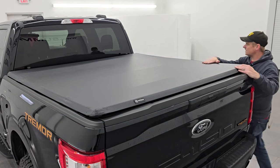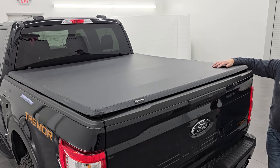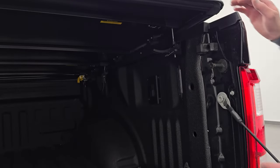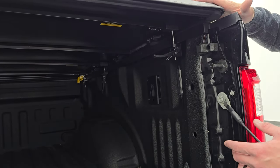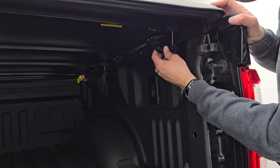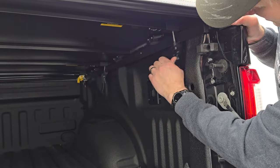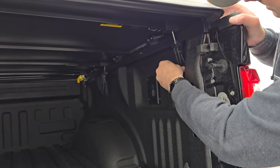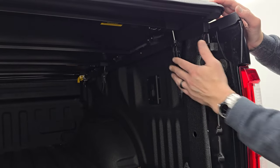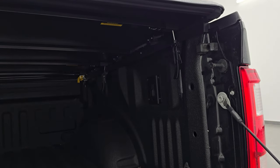As you can see, you get a nice flat surface and it's going to protect from rain, snow, any weather that you may encounter. And it looks really good. Real quick, one little tip and trick here — if the back end of the tonneau cover is sticking up a little bit, you don't have this clamp tight enough. So you're going to want to push down on there and just give it another turn. You can trial and error to make sure that you get it right, because you want it looking good, which it can — it's just a matter of having this adjusted properly. Now that we have it turned nice and tight, it's nice and flush with the bed of the truck and with the tailgate.